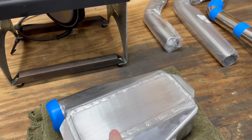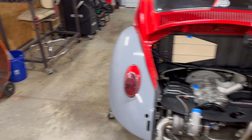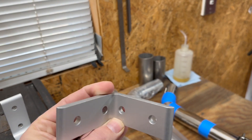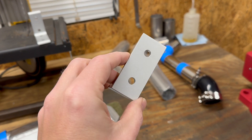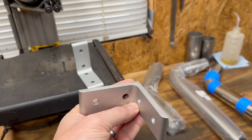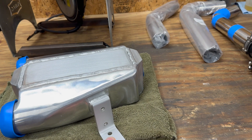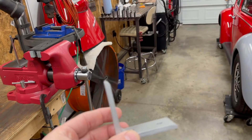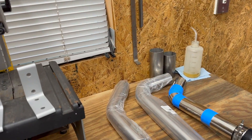So the goal for today is to work on the mounts to get the intercooler itself attached to the back of the firewall. Then I'll put the fan shroud back in and start working on the charge pipes. For the mounts, I'm going to start with basically an aluminum 80-20 bracket. 80-20 is an aluminum extrusion you can get in a bunch of different sizes, and you can use it for all sorts of construction projects. I'm pretty familiar with this stuff because I use it professionally quite a bit. I was able to get a couple of 90-degree brackets online that should work pretty well to attach the intercooler directly to the firewall using the two mounting tabs on the intercooler. I'll make a few trims and put another hole in to make it work — I think this will make for a fairly nice finished bracket without a lot of effort. Then from there we'll start working on the charge pipes.